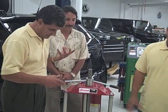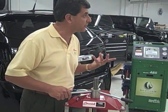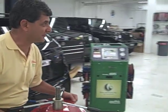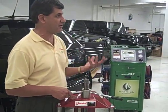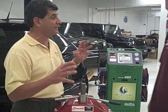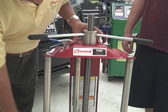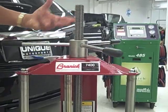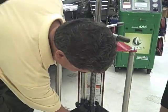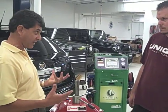What we've got here is our 7400 strut spring compressor. Sage, this is for you my man. Basically this handles any strut that you're going to have to deal with and you won't need any adaptors. It's got plenty of stroke. It's got this adjustment for helix angle on the top so it'll adjust to any helix angle on the spring. You can either grab the top plate with these top hooks or you can actually grab the spring if you're doing some spring work.